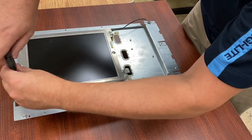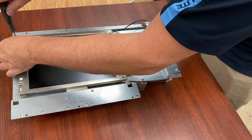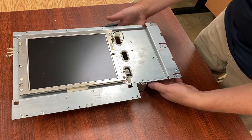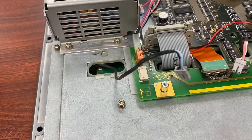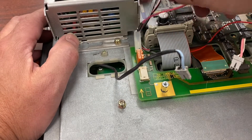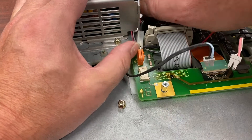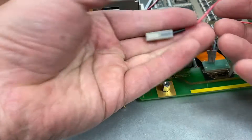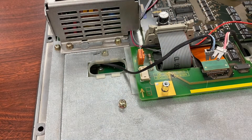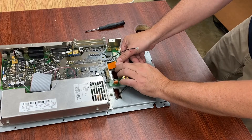Once you get it all together, you don't have to take it apart to secure that cable again. There are the four screws back into place. Now, the original CCFL bulbs run approximately 330 volts, so you can't use the same inverter that Siemens provides — we have to put a new inverter on. This little wire has to be removed from the power supply. This is super important: remove this wire because it's not needed anymore. The original inverter is inside that power supply and we don't need that part of that circuit.